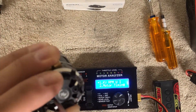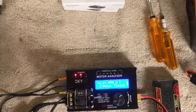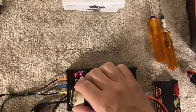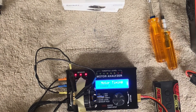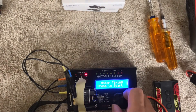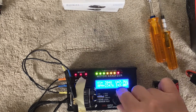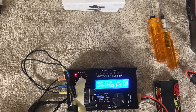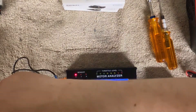That's not necessarily optimal, and the numbers don't correlate exactly as you'll see in my data sheet. I generally start at the 30 mark, but it reads differently — the 21.5 reads 26 degrees at the 30 mark, and this one reads 25, so about five degrees off. Once you go higher they get a little closer. You really need a motor analyzer to make sure you don't over-time them, but you can also base it off heat — about 50 degrees is a good marker.